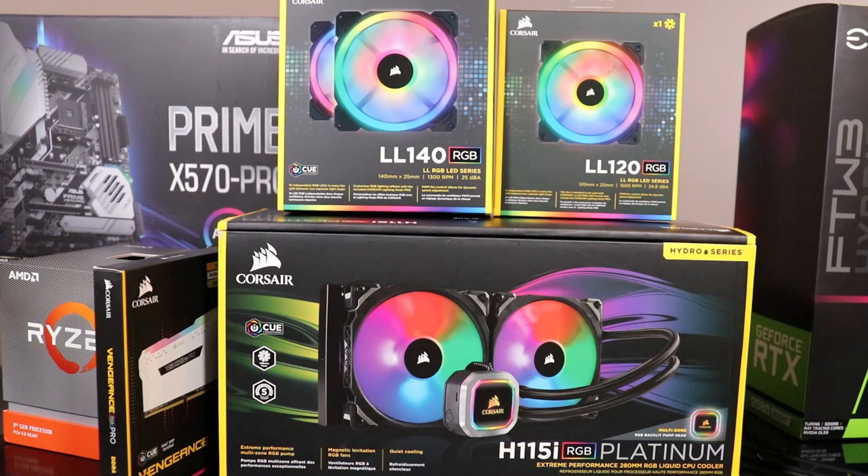For cooling, we will be keeping our CPU as chilly as possible with the Corsair H115i Platinum 280 millimeter AIO liquid cooler. The good news is that Corsair's regular fans are already black and white, which is perfect for our build. The bad news is that this cooler comes with Corsair's ML140 Pro RGB fans — fantastic fans. Those fans have a ton of cooling power and are extremely quiet due to their magnetic levitation technology, but they only come with four RGB LED lights compared to the 16 RGB LEDs in the LL series, and we just can't have that in a pretty aesthetically driven build.